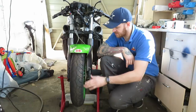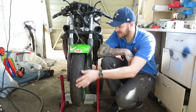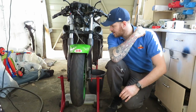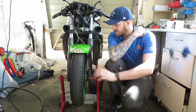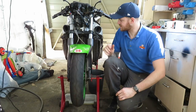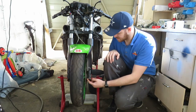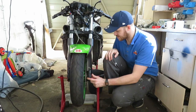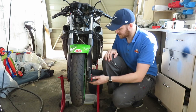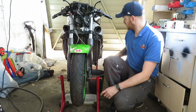And we're on the third day of taking things apart on this. As you can see, the wheel spins really nice. The calipers are up there still. I need to rebuild the left hand side one. So I've got to do the rear one, but first I'm going to take the forks out. And to do that, because the pinch bolt here is broken, seized, I'm going to take all the front end off to work and drill it through and whatnot.